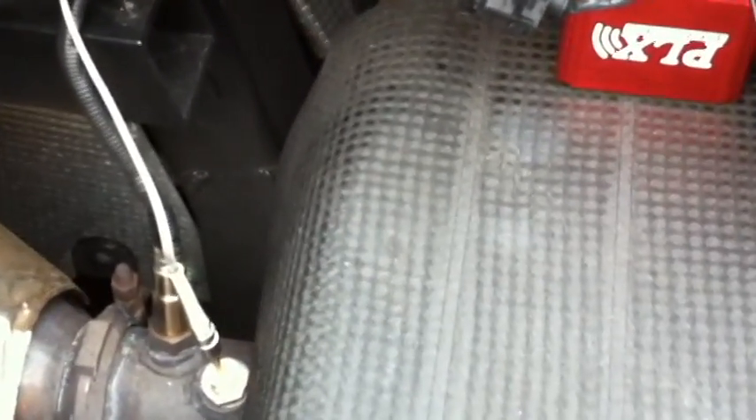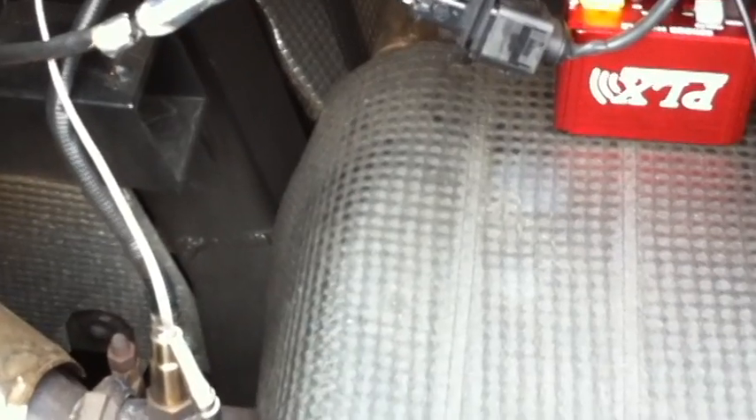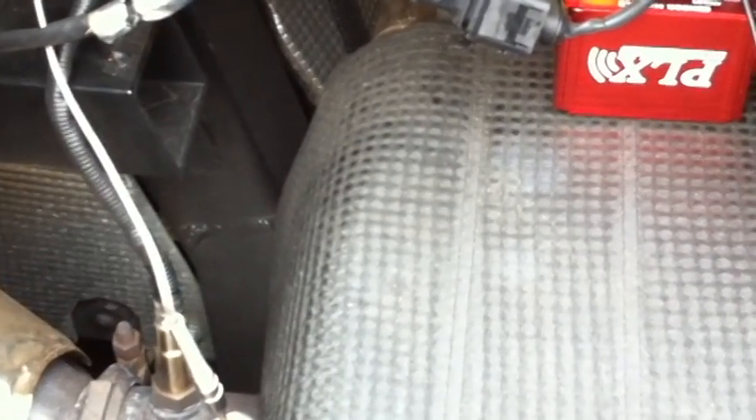If you've seen one of my earlier videos, I installed a wideband air fuel ratio sensor on the right bank of my V10 engine, and on the left bank of my V10 engine — you can see there on the bottom right of the screen. So what I've done here is I've added two more sensor modules, and it took me about an hour to do today. Really simple.